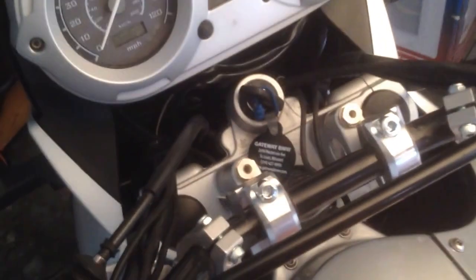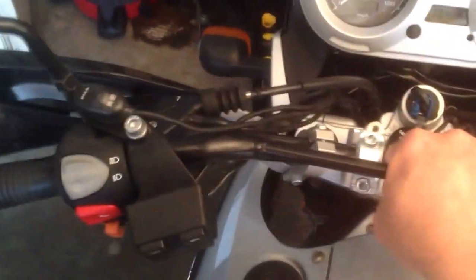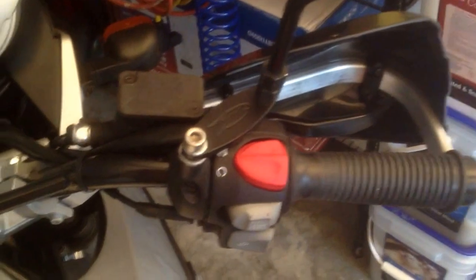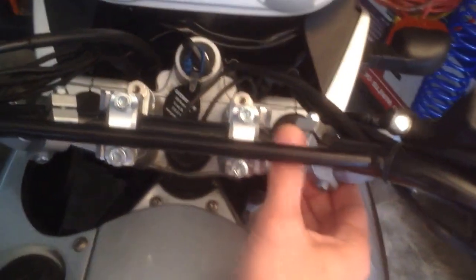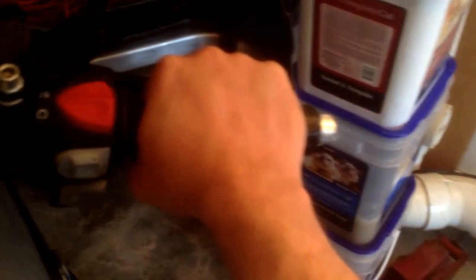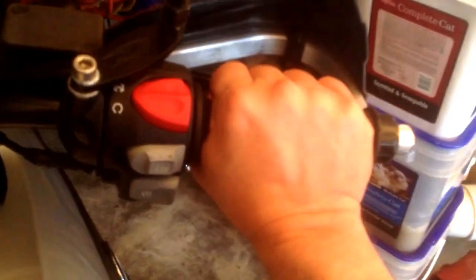I'm not sure the dealer itself is evil, but the mechanic was a schmo. He did sort of a choppy job, and when you're paying BMW dealer rates you just expect better. The bark busters were completely loose, and the bolts were in the wrong side so they didn't intersect the nylock nuts on the back — those would have vibrated right out. They clearly never rode it, because this whole housing was jammed too far into the end here and you couldn't get the throttle to roll back. You had to push it quite hard to get it to go back.